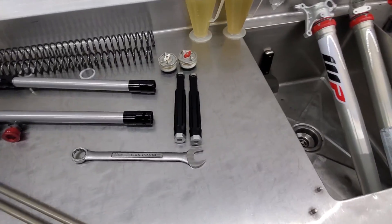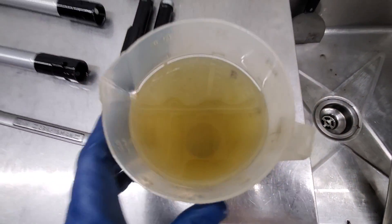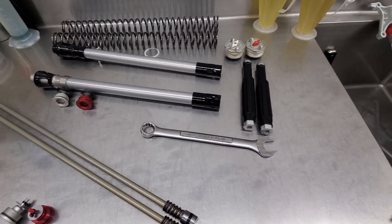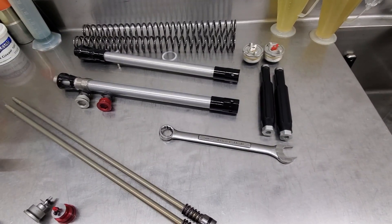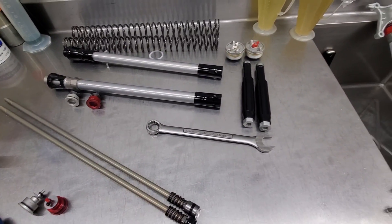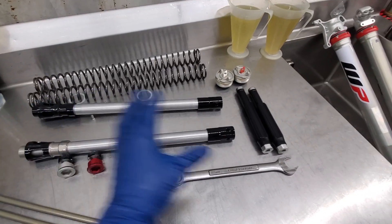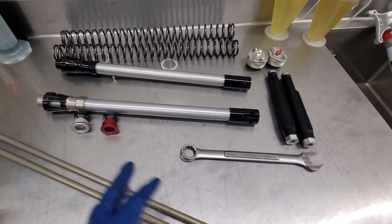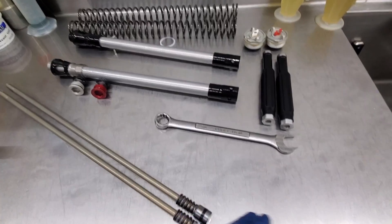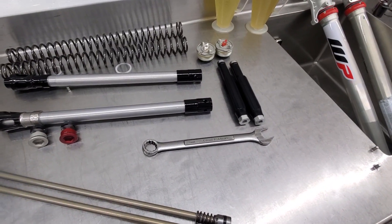One other side note: probably not going to be able to see it in the oil because it's all settled to the bottom, but there's just a ton of crap that comes in these things stock. You definitely want to service them after ten hours — even if you've got to do it at home or have your local shop do it, just dump the oil at about ten hours. That's what they recommend in the book, and that's what we recommend too, because it is absolutely full of garbage. You've got a lot of surface area, brand new components that have been sitting in warehouses and on shelves, and as much as they try to keep the stuff clean, it will drag a bunch of particulate matter in there with a lot of new machine surfaces being seated.